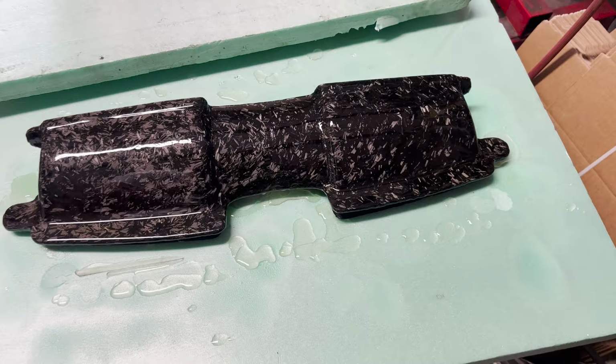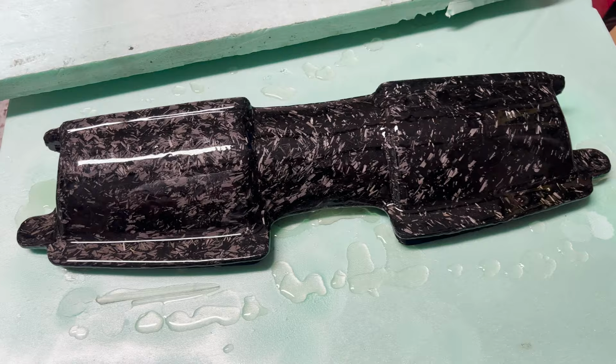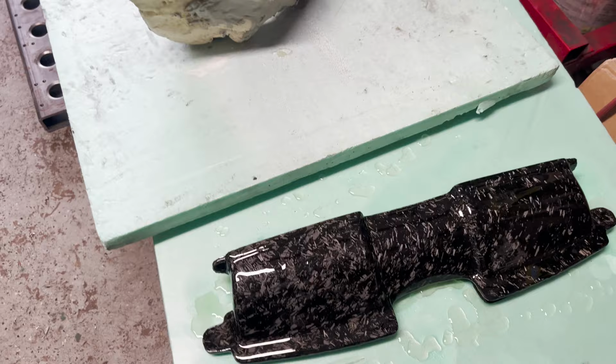For those of you that follow me on social media like Instagram, the BMW pages on Facebook, or even my TikTok, you see a bunch of my carbon fiber work. I am still very, very busy. We still have turbo manifolds and everything we're working on. But to show you a few pieces, this is the front air scoop, the one you open up the hood. I'm doing this piece in forged carbon, so it's not complete yet. The resin's still drying. I still have to do sanding and wet sanding, then clear coat and then polish.